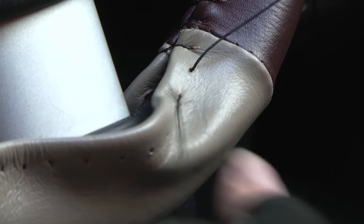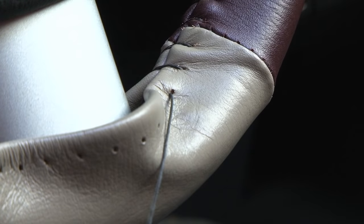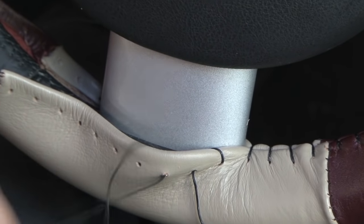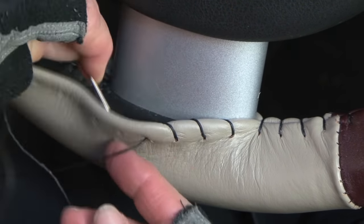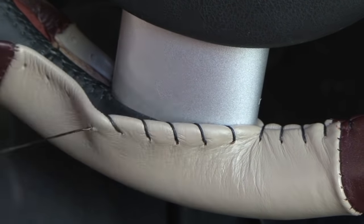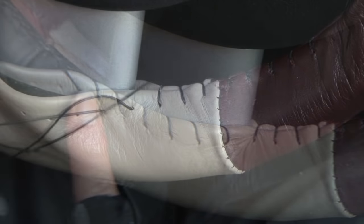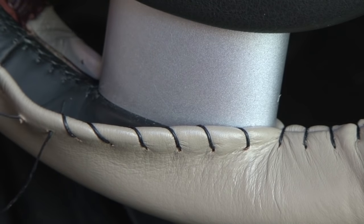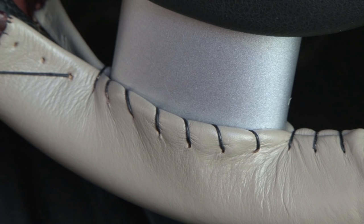The lacing holes on your WheelSkin have been matched so that there is an identical number on each side. You should use every lacing hole. However, if the spokes of the wheel are wider than about one and one half inches, we recommend that you lace only the front holes at the spoke with dummy stitches. This will fill the front holes and help to hold down the cover over the spoke. Just remember that for every front dummy stitch that you make, you must skip a rear hole behind the spoke. Try to have the last real stitch before the spoke come up partly onto the spoke, and the first real stitch on the other side of the spoke come up partly onto the spoke. This will help to hold the cover down tightly over the spoke.